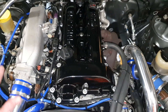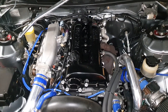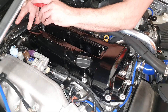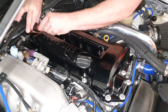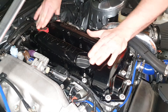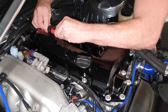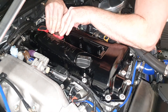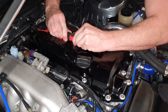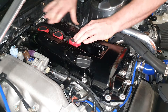If you clean your motor down, just clean around carefully — I accidentally got a bit of water in number four. It didn't affect the performance, but it could have if I'd got a lot more water in. Fortunately it was just a little sprinkle. Now for the fun part — putting the coil packs back in. I've pushed down and you can feel the actual coil pack click onto the head of the spark plug and then I know it's secure. If anyone is concerned with the stability of the coil packs, the clamping of the coil pack onto the spark plug is actually quite good. They're solid — once they've clicked on, they're not going to go anywhere. These coil packs have been great. Definitely a worthwhile upgrade if you're considering it. Maybe consider getting the bracket with the appropriate seals to make them watertight.